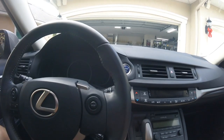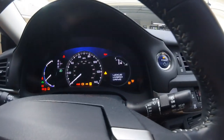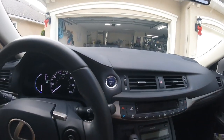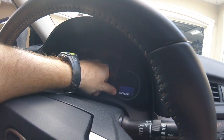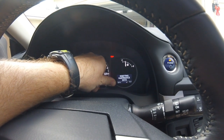Of course, it's a process. In my XB it's like two seconds done; in this car it's like, pat your belly, rub your head, hop on one foot, scratch your back, and then do a 360. So after watching a YouTube video, let's see if I can do it. First, with your foot off the brake, press the power button to illuminate everything. Make sure you're on Trip A, then press the power button again to turn it off to the odometer reading. Then hold down the trip button and hit the power button. Keep holding — 'resetting maintenance data,' you see the little countdown, dashes, all zeros. We're good to go.